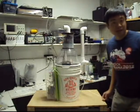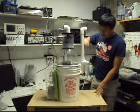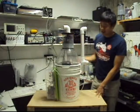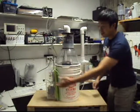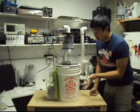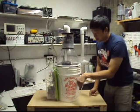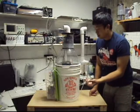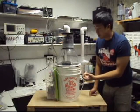So let me show you how it works and what it's made out of. Dirty air goes into this port, goes down, and then gets cleaned, and then comes out here. As the dirty air goes in, there's a high voltage circuit here — it charges and ionizes the incoming air. It enters water, swirls around, and is attracted to the water. So the water is scrubbing out the particulates.